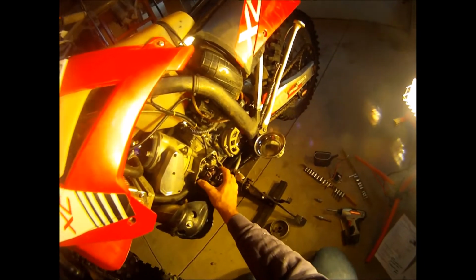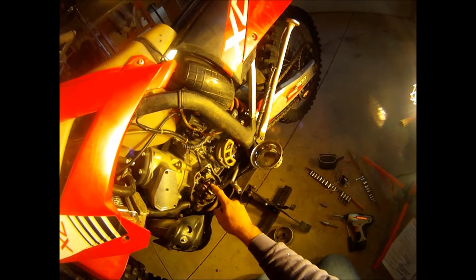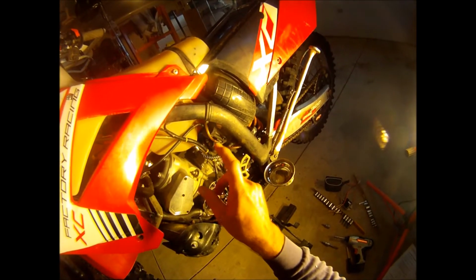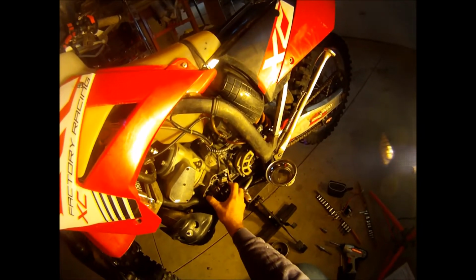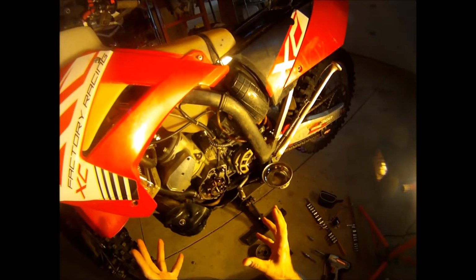It makes perfect sense the way he explains it. And so this stator has two wires, has three wires, if not four wires, I think it's four actually, that come off this, that power the motorcycle's ignition side as well as the lighting side. So basically it does two different things. It powers the ignition, which fires the spark plug, and it also powers the lighting. Those are two separate systems, okay? And they're both AC on this bike.